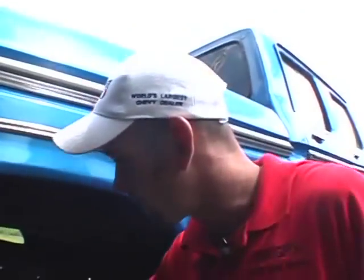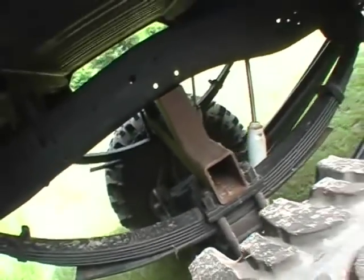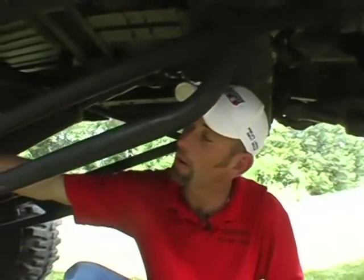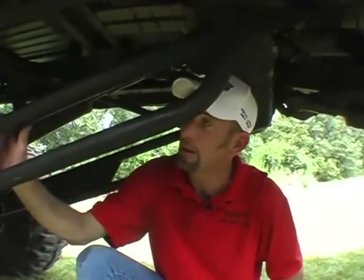This here's my lockout block. Put it in place to add direct pressure to the tires during tug of war. I had to beef up the traction bars. I did just have a primary bar in here, but the abuse that I put it through, I ended up bending 4 or 5 sets.